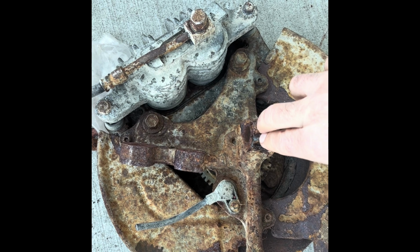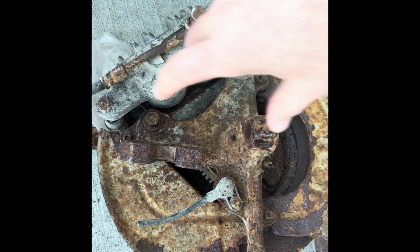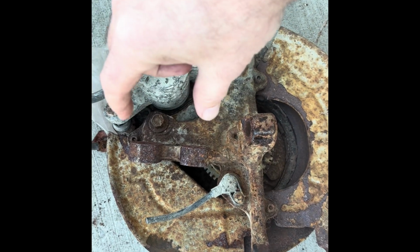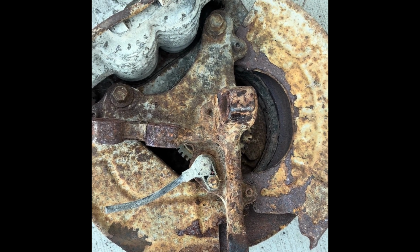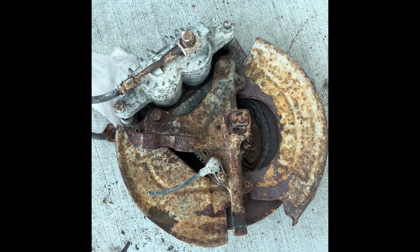And let's say on the Fox knuckle, when this was a little bit higher, that left the shock a little bit farther travel to go down. So now that this point is located farther, my strut already starts 3/4 of an inch stretched out more. So yeah, strut extension going on there. Gain a little bit more travel.